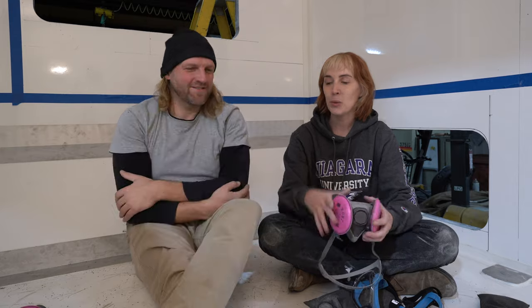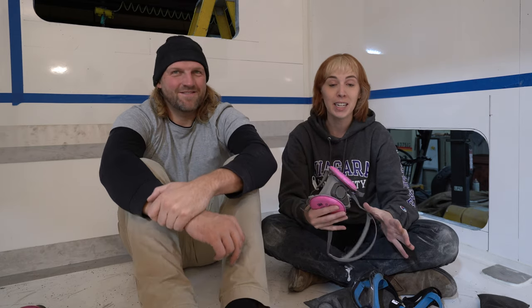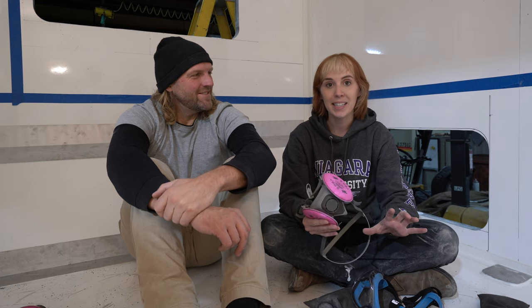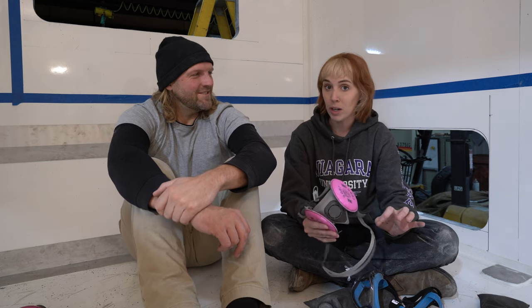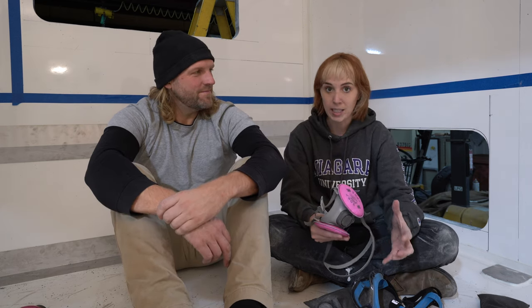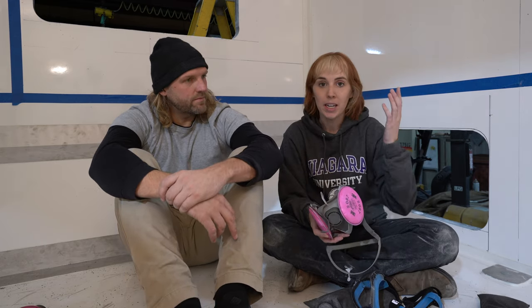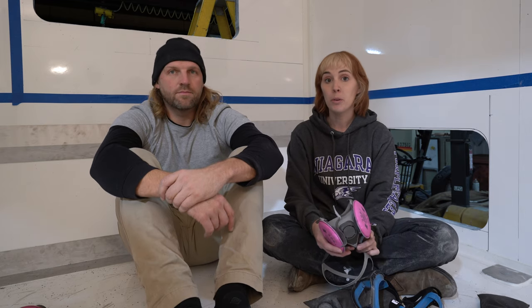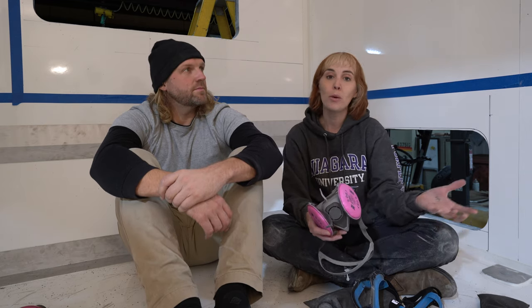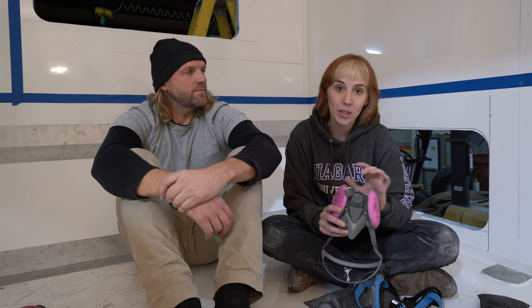That's what we discovered. So we talked to the guy at Sherwin-Williams and he couldn't guarantee seal of approval. This paint will be fine in a shower. But he said there's a very good chance that it will work as long as we really sand the FRP and give it a really good dry time in between coats. And he did say it'll have no trouble being in all the other areas of the camper, so we're good for that. It's just the shower that's the question mark in this. But we're willing to try, and now the first step is getting into all of the sanding.